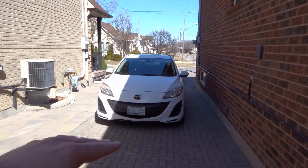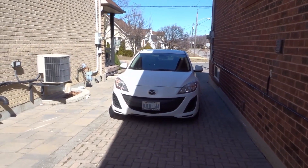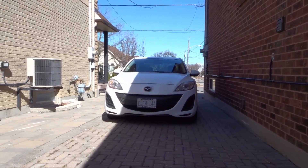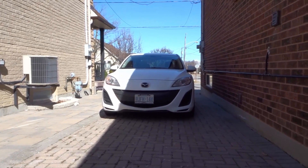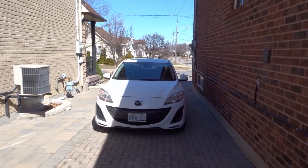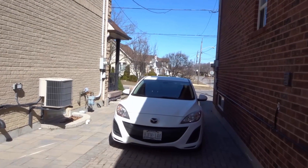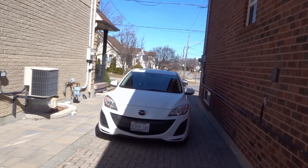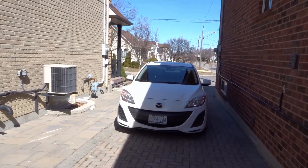You want to make sure that the car is parked on a level surface. Stand a decent length away from it — right now I'm probably about 10 to 12 feet away. Crouch down and look at whether or not the car is level. Do this from both sides and the back. If the car is sagging to one side, that's a good indication to look into the suspension further. If it looks nice and level, you're most likely okay — though that's not a guarantee.